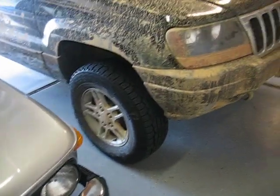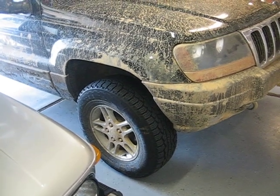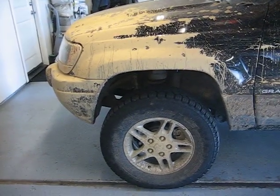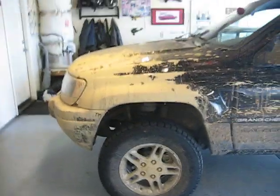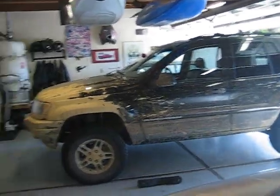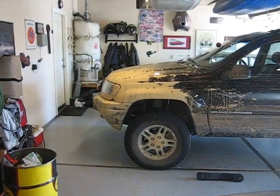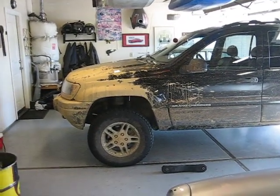The good news is one of my good buddies, Josh, was there. He saw it happen and walked me through the process of putting it right back in, so we were good. But the problem is when you disconnect your sway bar with this 2-inch Rough Country budget boost, the shock absorbers are way too long. I don't feel like Rough Country has appropriately matched this shock absorber to the budget boost kit, because you shouldn't lose a spring with a 2-inch budget boost. When I pulled the shock absorbers and compared them side-by-side to the stockers, these shock absorbers allow 4 inches more travel — I feel like all you would need is an extra 2 inches. Shock absorbers too long, sway bar disconnected, you lose a spring. Dangerous. Terrible.